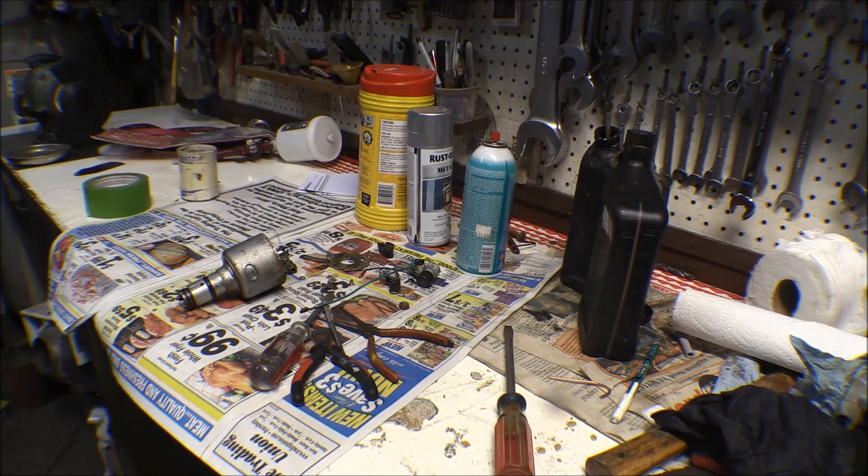There was sawdust on top of the engine and on pieces that didn't get cleaned off properly. Over the years the moisture reacted with the sawdust, and the top engine case — which is magnesium — had started corroding pretty good. Some of the other parts weren't much worse than before but were kind of rusty and stiff. So I pulled a bunch of parts and pieces off of it, cleaned the engine up and painted it, and sandblasted a lot of the parts and pieces and repainted them.